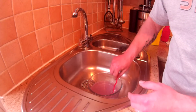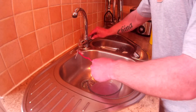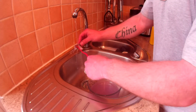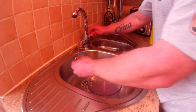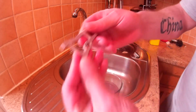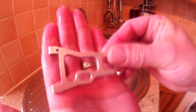I'm going to have a look at the part and pull it up, then run it under the cold water tap just to stop the anodising process and not burn your fingers. If you do this and there's still colour on there, just pop it back in. As you can see, that's pretty good - nice and silver.